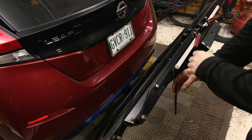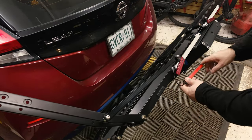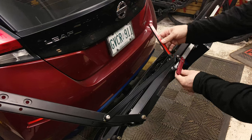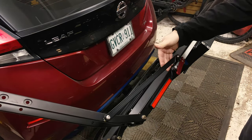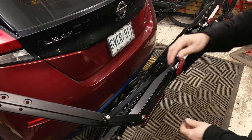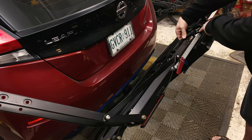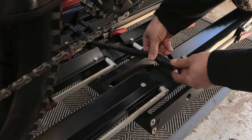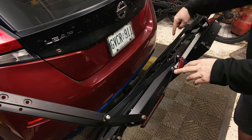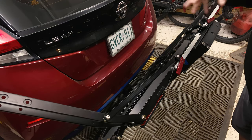I'll raise the arm up out of the way to show the routing — I put a tie wrap at a couple of locations so the wire doesn't wander or interfere with anything. I loop it so there's no wire the tire can rub on. The wire runs out to the bottom where I have looming with a magnet adhered to the rack — you can hear the click as it snaps in place. I also have a magnet on the harness on the car itself so it doesn't flop around or drop onto the road while driving.